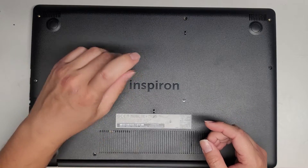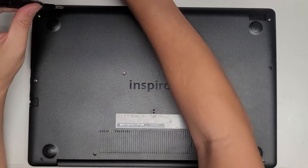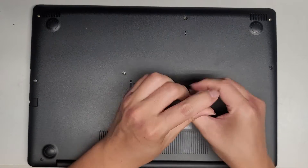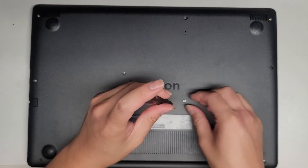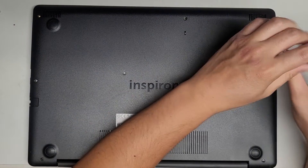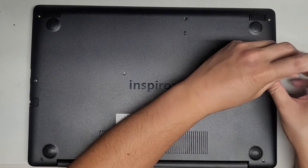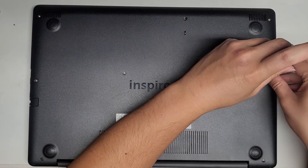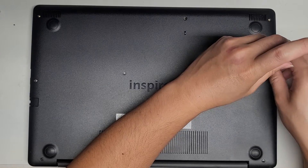If you're doing this, you'll either want to clone your hard drive to the SSD first, or if you're doing a clean install, you'll want to make sure you have a Windows USB install drive. If you don't know how to do that, just let me know — I have a video showing how to create a bootable USB. Your USB will have to be at least 8 gigs.